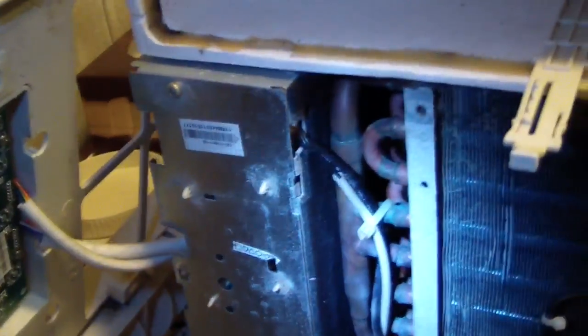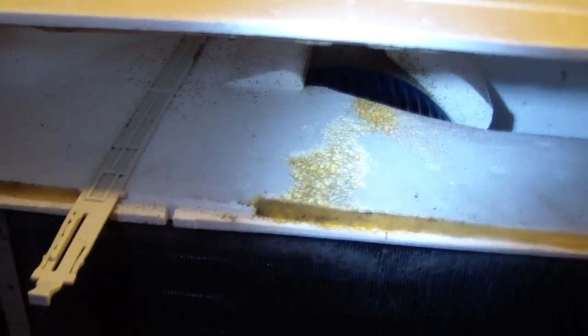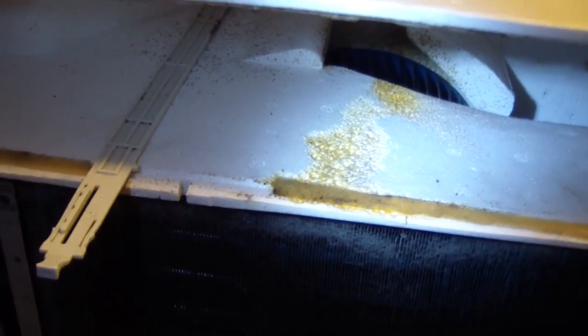Remember, you want to do this where there's no power to it, otherwise you will be fried. My coils look alright — I mean they're not great, but all things considered it's not bad at all. That yellowing is from one time when I was desperate, I got tired of hearing the noise before I realized the bearings were replaceable, and I used liquid wrench. Don't do that. So now that you have that top cover off...